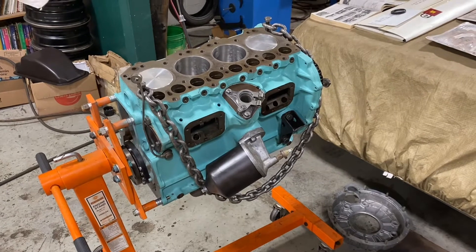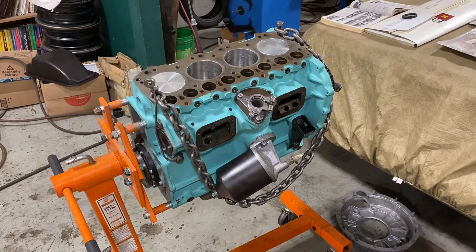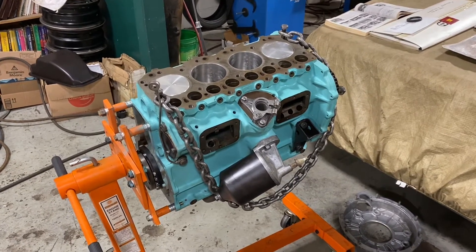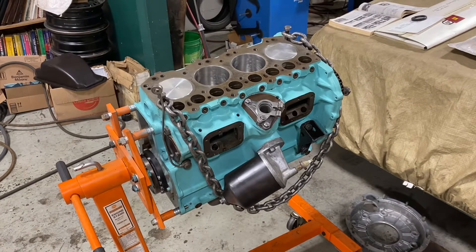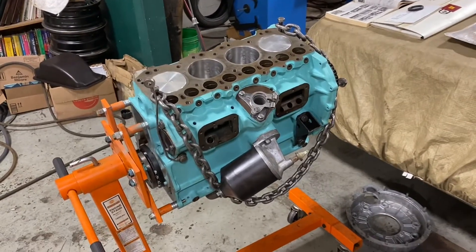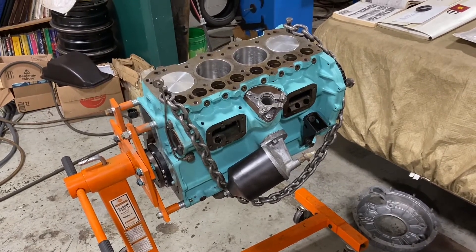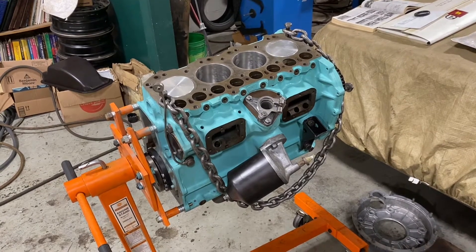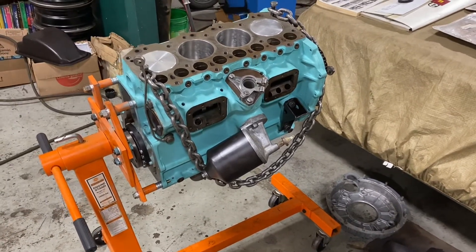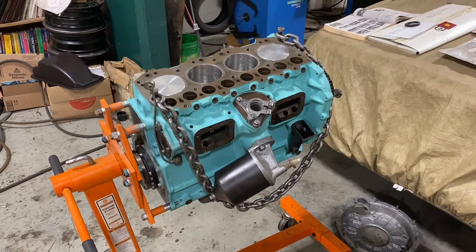This was soon modified, around 1958. They put the new two-and-a-quarter litre engine in the station wagons, but kept the old two-litre IOE engine in the short wheelbase vehicles for a little while. Then around 1960 those also got the two-and-a-quarter litre engines. When they changed from a Series 2 to a Series 2A, the engine changed again. The reason was to introduce the diesel engine, and there was significant parts commonality between the petrol and diesel engine, sharing the crank, bottom-end bearings, and the block.